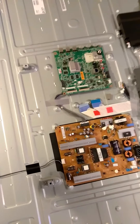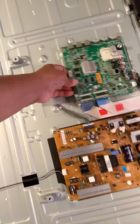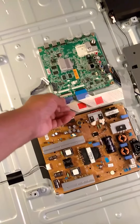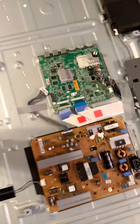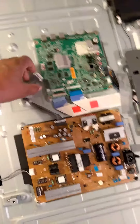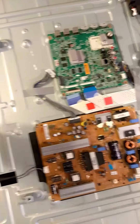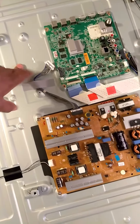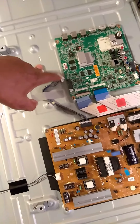You had to take all the screws out. This is the motherboard — as you see, I've already taken that out, and it sits right here. These two plug in here, and you have to be careful not to bend these ends. There's a little locking mechanism here that flips up and down. If you've never been in the back of a laptop or any new electronics, some of this may be new. These little squeeze triggers help it slide in and out — you got to squeeze them together, hold them, and then pull it out slowly. If you yank it, you yank the wires out and mess with the connectors on the inside.